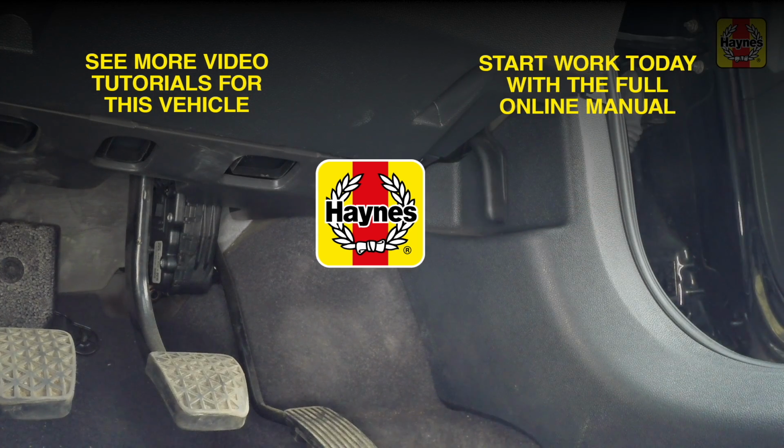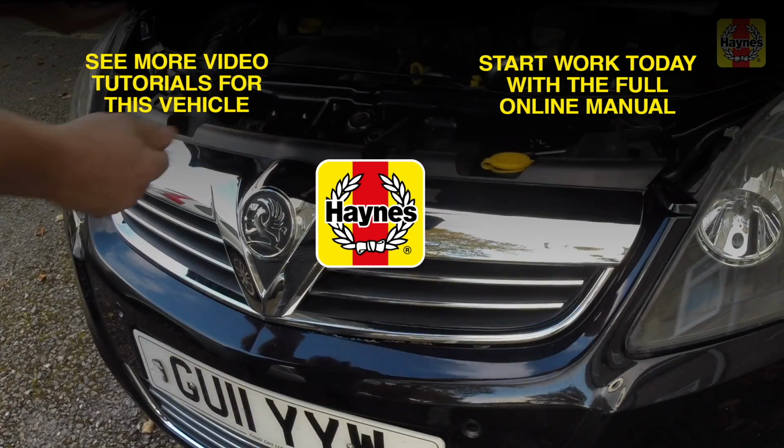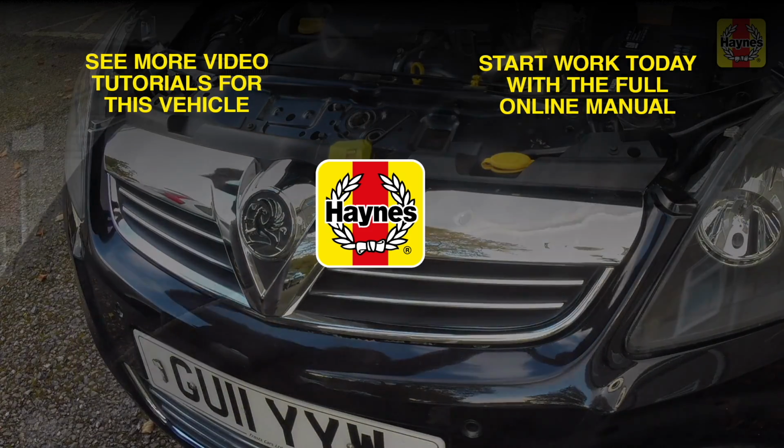Pull the bonnet release handle in the driver's footwell. Release the secondary catch, open the bonnet and support it with the bonnet stay.